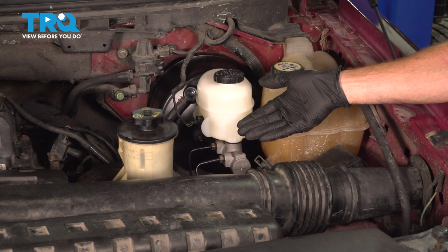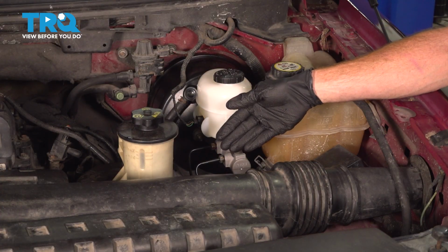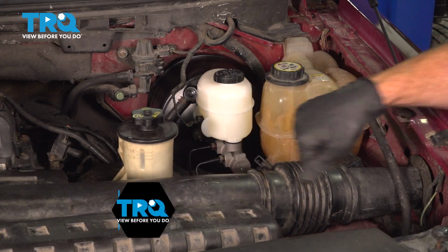The next thing that you want to do is make sure that you hop in the passenger compartment, pump up the brake pedal, and confirm that it stays firm. After that, reinstall every one of your wheels and torque those lug nuts to 150 foot-pounds and take your vehicle for a road test. Thanks for watching.